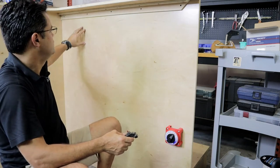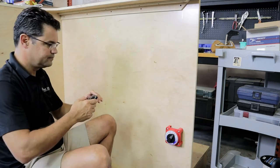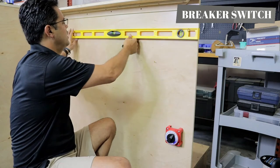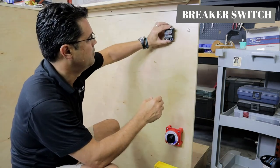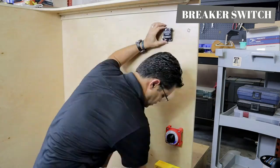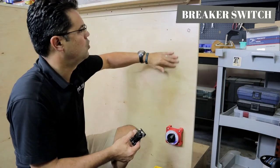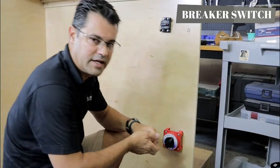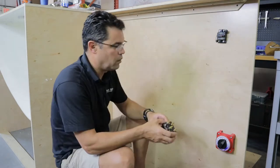We're going to turn the wiring to a horizontal position and bring it into the bolt kit over here. Next is your breaker switch. I've made a horizontal line here using a straight edge with a level — you can barely see it, but we're going to use that as our reference to mount the breaker right here. Now that these two holes have been drilled, I'm just going to fasten this to the wall with quarter-20s. Now your breaker is secured and mounted.